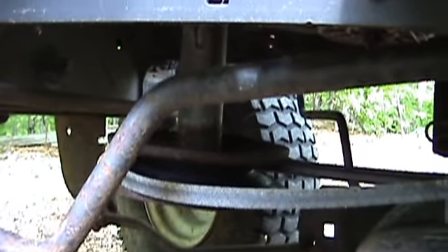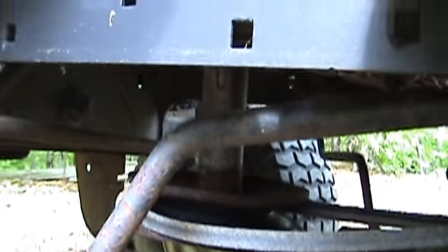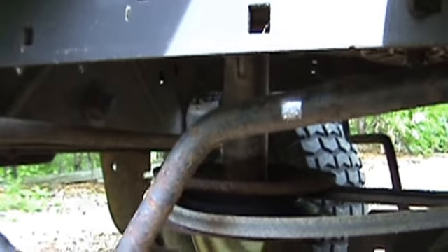There's some slippage at the PTO belt and I'm thinking that's why — there's probably half that belt not there, it's just old and worn. But it will spin the blades and it will mow the grass; it'll just start to slip in the heavier stuff.